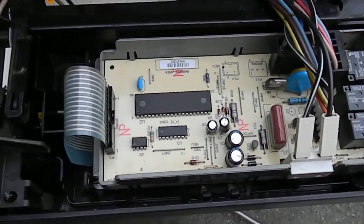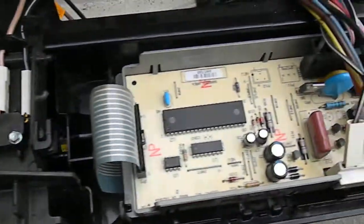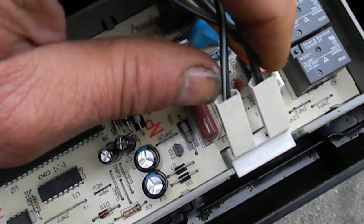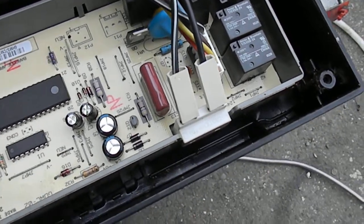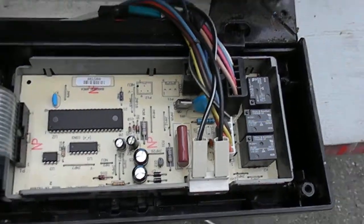What happened was underneath this control board, I checked the switches for continuity — they activate as expected. On the other side of the board, it looked like there were some ants or something in there with their little debris trails. This is the fuse and you can pull it up and check continuity here. If you've blown that fuse, you'll need to get a new one. But it's likely there's another related problem when you find one problem.